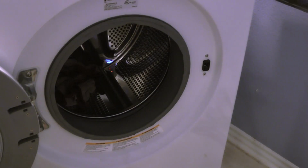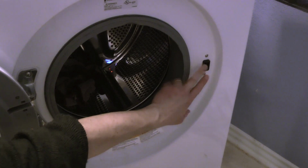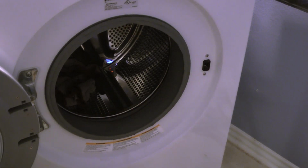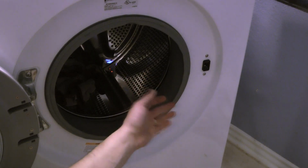So one additional step that you need before you actually replace the front door is to connect the electrical connector to the door, into the door lock here. Don't forget that, otherwise you have to redo everything.